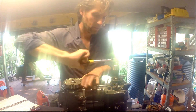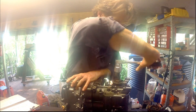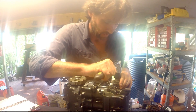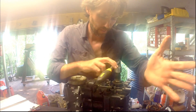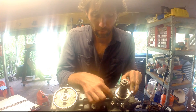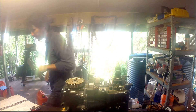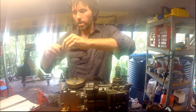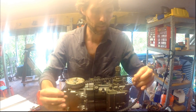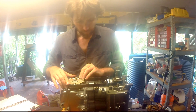It's actually a little bit past top dead centre so I'm going to go around again — went past again. This is a little bit stiff which kind of worries me. Alright, so now we've got these four marks — two pairs of marks — lined up. We know we're all good in position, so I'm just going to grab the timing belt. The timing belt looks to be in excellent condition so I'm not worried about putting this one back on. I get the impression it was replaced not that long ago.